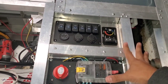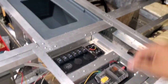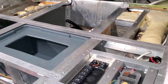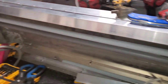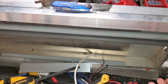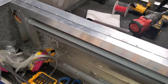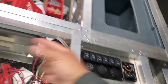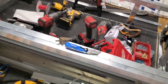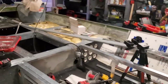All we did was make it more compact, more concrete, and completely aluminum — there's no wood hybrid framing in here at all, with the exception of the back. I really wanted the back to be as solid as possible and not move, which is why we stuck the three-eighths back there. We have conduits running and hiding all the wires so you can run and rerun wires. We're going to run two more, so this will be a wall of four conduits. The two bigger ones will run the actual cables — the starter cable for the motor and the main wire supply — and those will all be ran seamlessly so you can access and take out and re-add stuff.